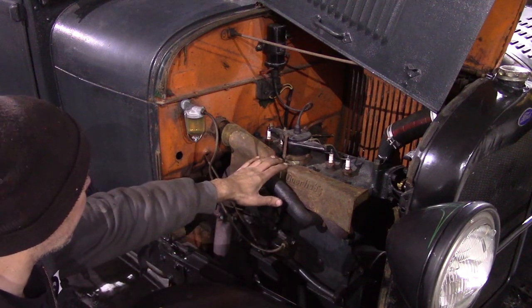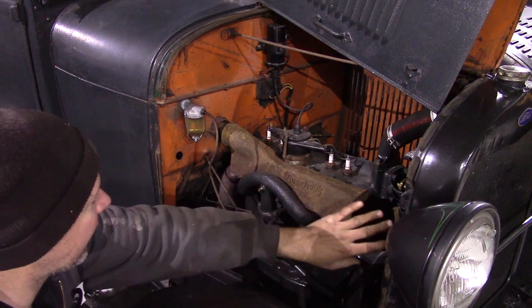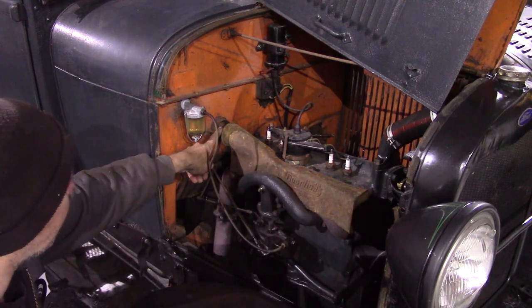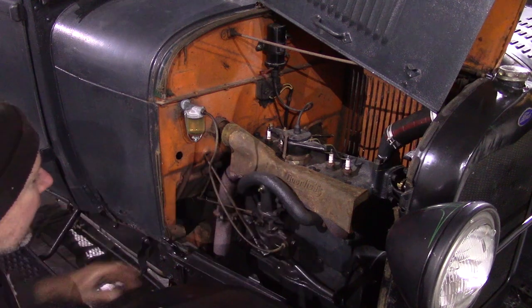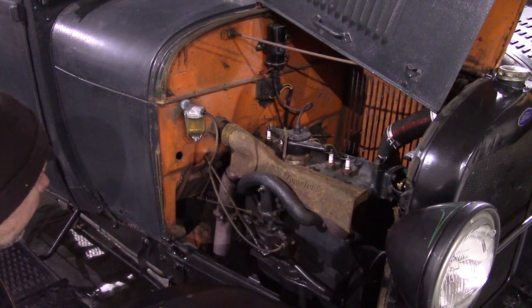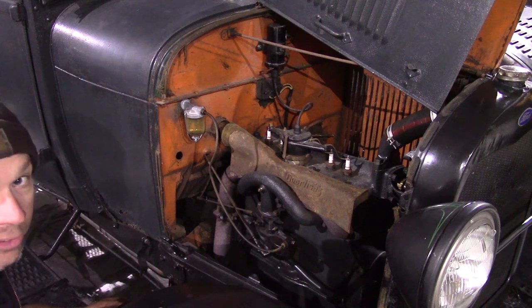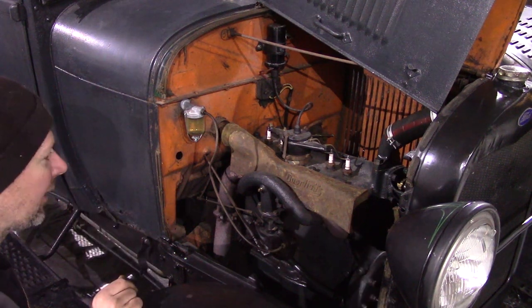I threw a heater on, a manifold on here, a Heatilator, which takes air and blows through here. The manifold heats it, and then it blows it into the cab here. I just threw that on. The engine runs good. It starts right up. I've done a bunch of videos of this truck cold starting in 6-degree weather. It fires right up.